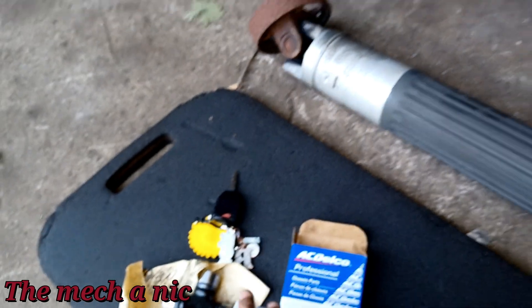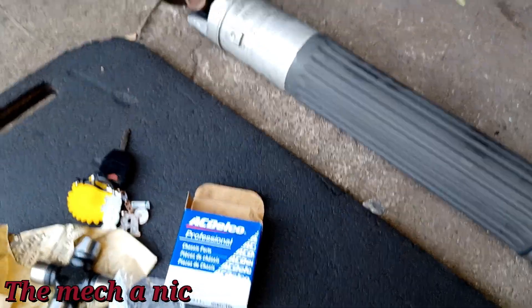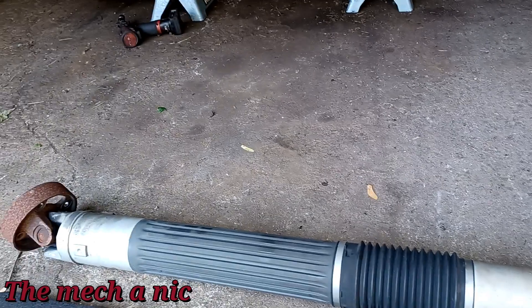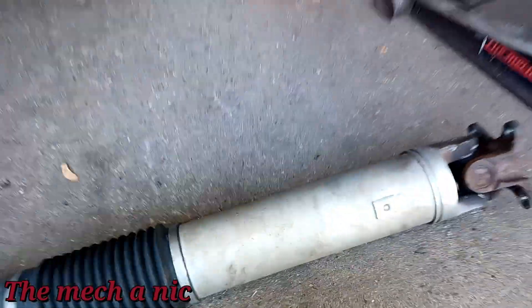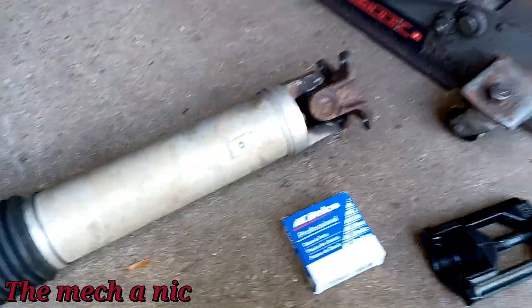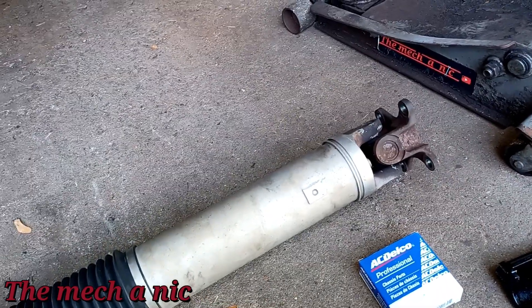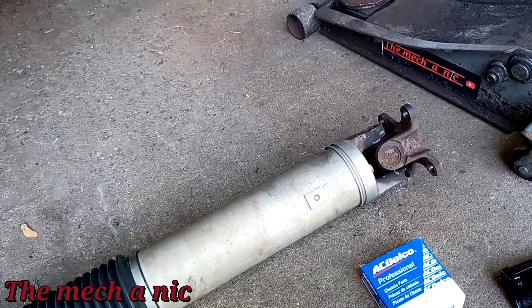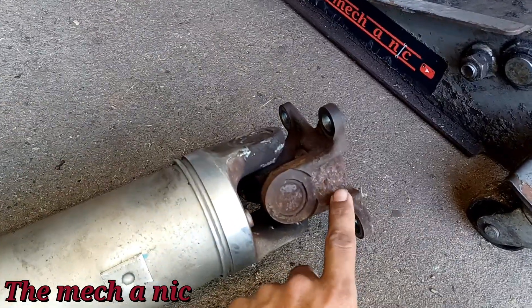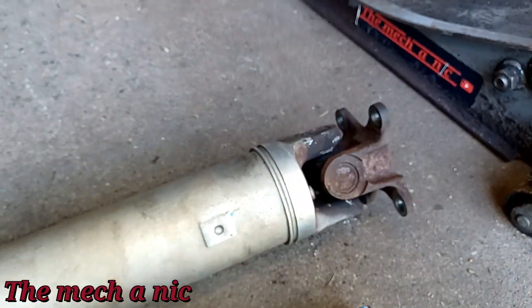The owner bought these parts off of Rock Auto. I went on Rock Auto's website and all of them say rear wheel drive. If you have the all-wheel drive model — which this one is — they are not offering U-joints for it because they expect you to replace the entire driveshaft. The company that makes these special U-joints is called Rockford, and none of this stuff is off the shelf — you can't just go to an AutoZone and buy it. It's all from that specific company.